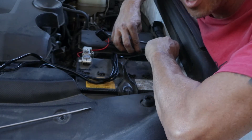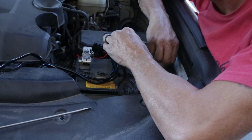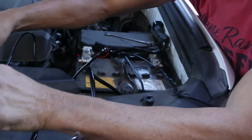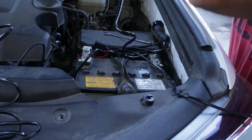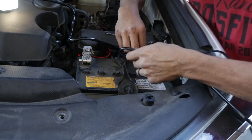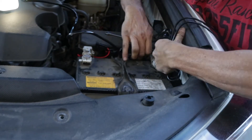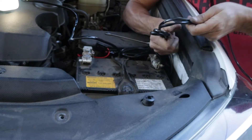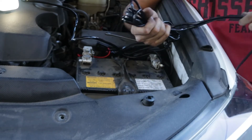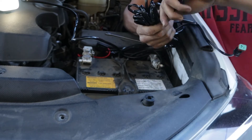With some of these wiring harnesses, you're going to have several feet because they're built to accommodate all sorts of vehicles. Since this is made for two lights, you're going to have two wires that go to the lights and then one for the switch. So as a temporary solution, these two wires — I'm going to zip tie these all together and combine all this excess wire, because there's a lot of it. I mean, I could totally rewire this and make everything shorter, but like I said, this is just going to be a temporary solution.